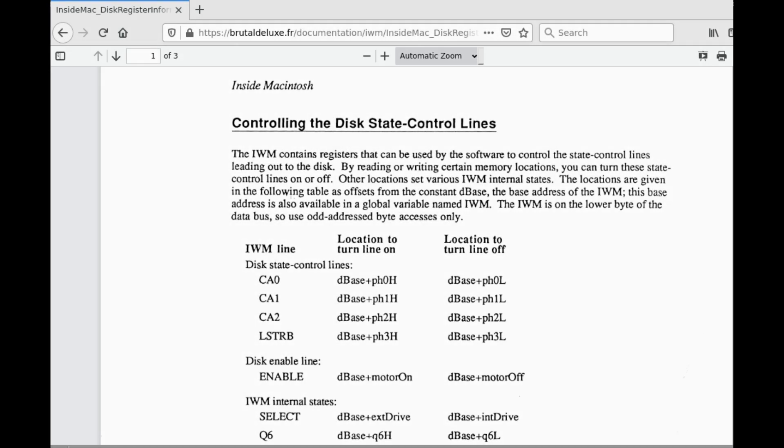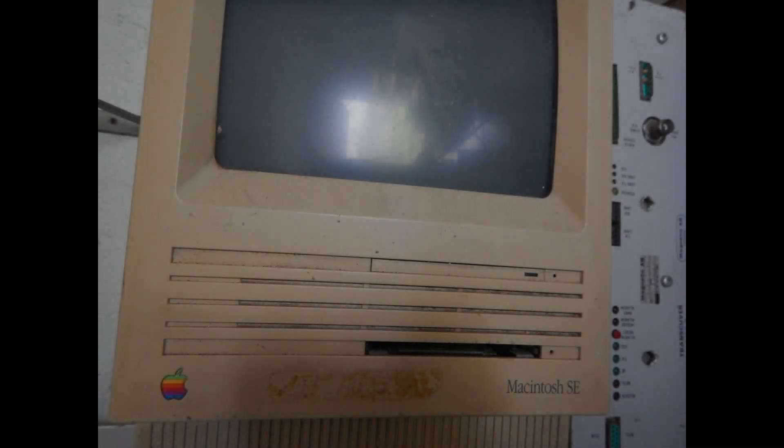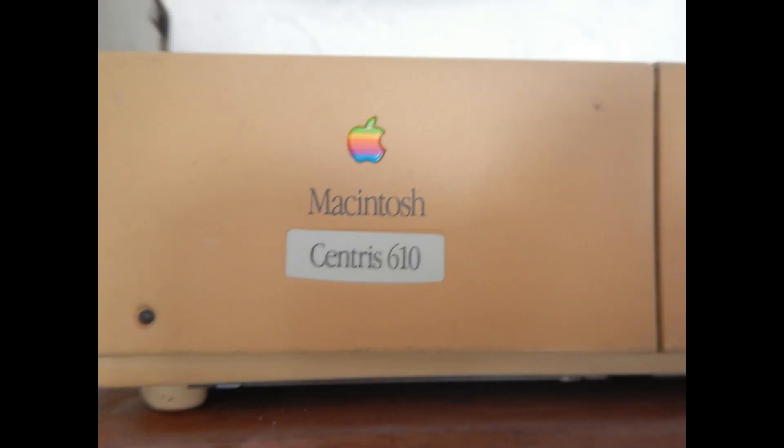The IWM IC has also been used in all early Apple Macintosh machines, since it was flexible enough to handle the 3.5-inch floppy drives via appropriate software control. I own quite a few Macintosh models, mainly from the years when they had no value anymore. Some of them have the DIP-28 IWM, like this Mac SE. Some of the newer ones have an enhanced controller with added frequency modulation and MFM support — on these, the IC is called the SWIM, and it is a 44-pin PLCC integrated circuit, so not compatible with the old IWM.